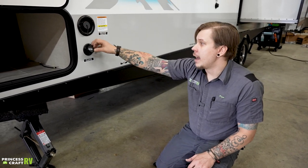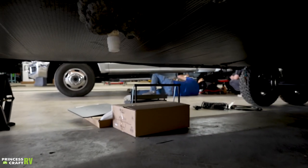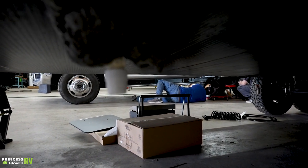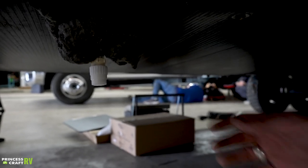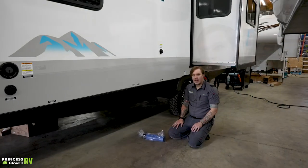Now we've covered how to fill the non-pressurized water tank. Next is how to drain it — clearly marked on the body, the fresh water drain is down below using a half-inch cap. It is a gravity feed system, so draining is as easy as unscrewing that fitting. When you return the unit to service or refill, you may need to give it a couple wraps of Teflon tape to make it water tight. The manufacturer recommends that anytime the unit is in storage for more than seven days, drain all water from the system. You only need to drain the fresh water holding tank if you've actively put water in it — but if you put water in and haven't used all of it, drain the remaining water before putting the unit into storage.